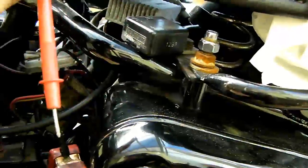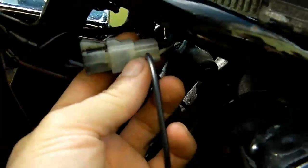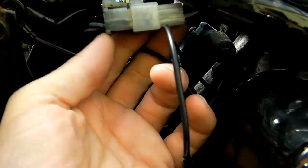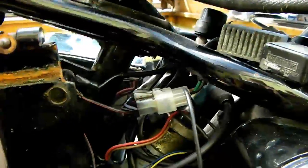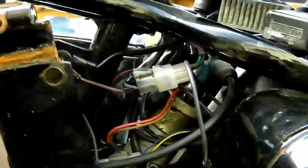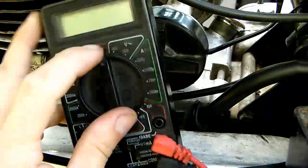What I do know is how to check that these are providing the correct voltage. You can either disconnect the bullet connectors and connect your multimeter probes directly, or — which I find easier — just undo this little plug here and touch your probes to the bottom two violet wire terminals. You do this with the engine running. At around half revs, you should be getting above 30 volts AC coming out of the generator. It's important that you set your multimeter to the AC setting.